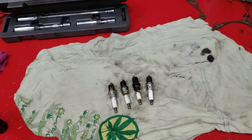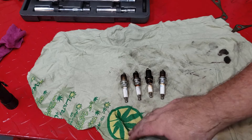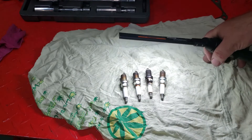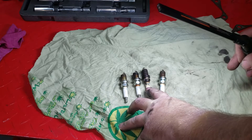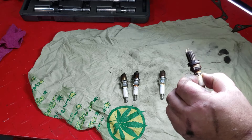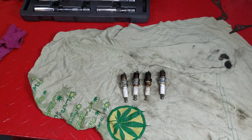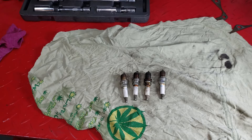Wide range of opinions here, guys — the first problem is it's got NGK plugs in it. NGK — don't put them in a GM. Opinions, opinions, opinions. I don't put NGKs in any Chevrolet. Fine wire, good plugs — not knocking the plugs — but I just don't do that. This is the one that has the leak I showed you, and that's going to make for a hot plug. It's got a little buildup on the spark plug, and the way these fine-wire plugs are designed, you can't really brush on them — that tip will just break or bend.